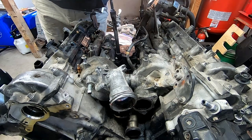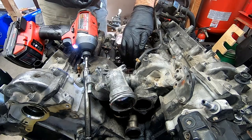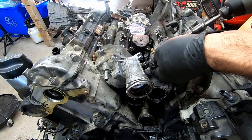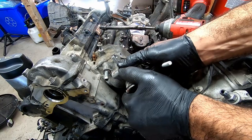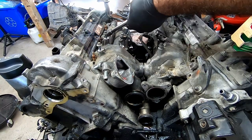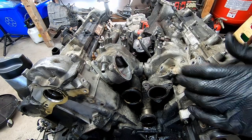This is the actuator for the flaps, which often go bad — so we have to get that out. Let's keep going with the manifolds here. First the thermostat — good idea to replace it, as the seal is probably going to fail eventually. The manifolds and the EGR cooler all seem to come out together.